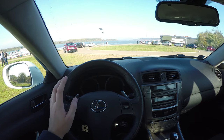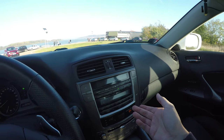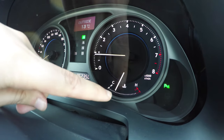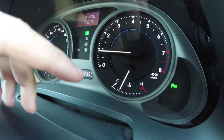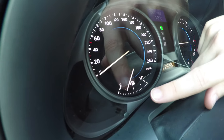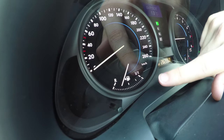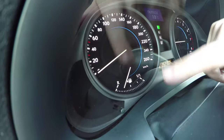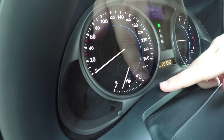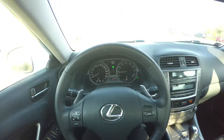Before the first step, you need to make sure your car is properly warmed up. Of course, your air con must be off for better acceleration, and this needle needs to be in the middle for optimal engine temperature. Also, a small tip: make sure your fuel tank is not too empty but not full either, because a full tank on this Lexus can hold 65 to 70 liters — that's an additional 65 to 70 kilos of weight.